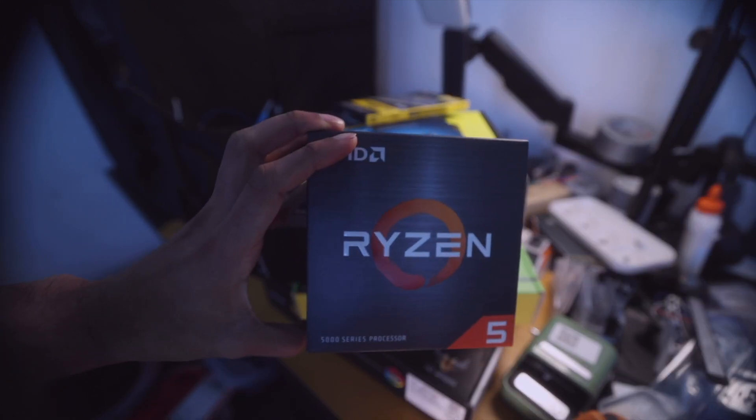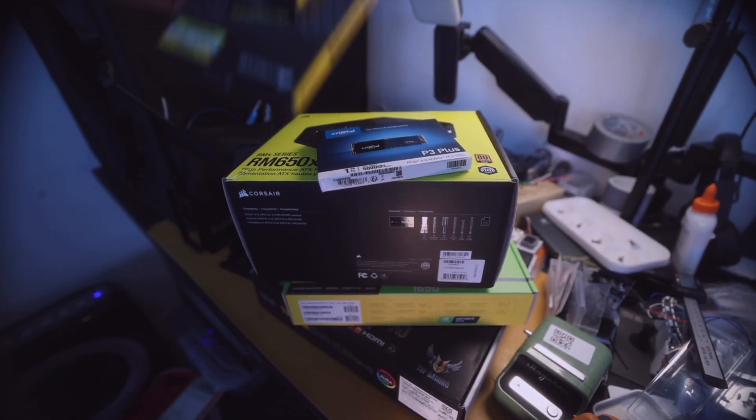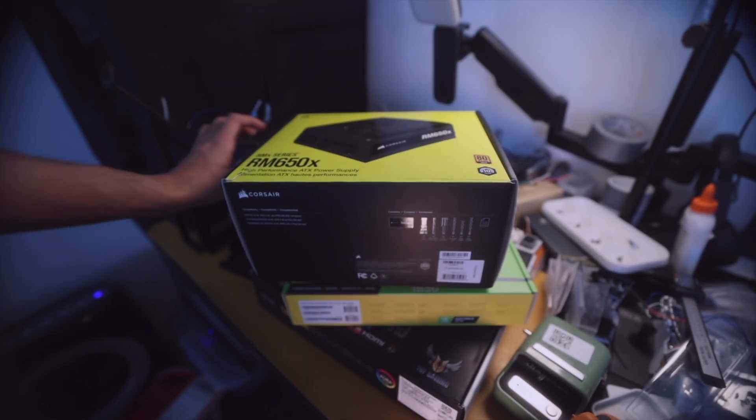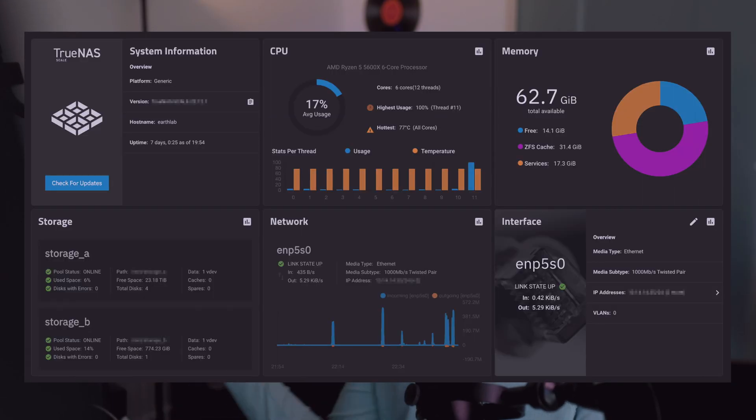To tell you a little bit more, the foundation of my setup is my AMD system down at the bottom. It's built into a 2U chassis, it's got an AMD 5600X CPU, it's got 64 gigs of RAM for all of my virtualization needs. It's got 75 terabytes of disk storage for my media and NAS server, and even a couple of SSDs for all of the applications I want to keep running on it. I run TrueNAS Scale as the base operating system, which essentially combines NAS software and virtualization servers, so it lets me do everything I want to do with this build in one interface.